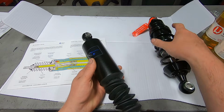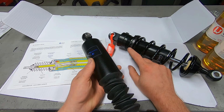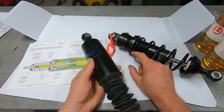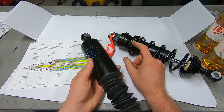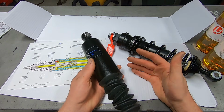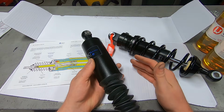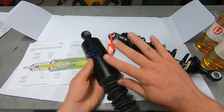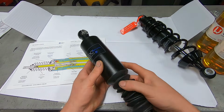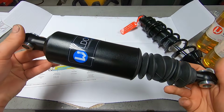In the normal setup, you would know where your spring collar is, and then you'd add weight to the motorcycle, and then you'd adjust this a little bit, and then potentially turn some knobs, and then put the tour pack on, do that same thing, and then if you want to ride the motorcycle by yourself, you undo all those things. That's a lot of taking the saddlebag on and off, remembering, doing, adjusting. It's a lot of stuff to get the best ride quality. That's where this entire cylinder does all of that by itself.